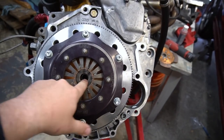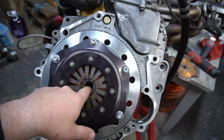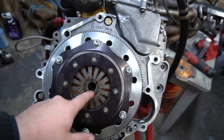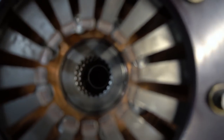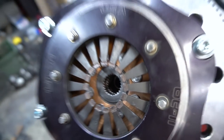We reached out to a friend at USP Motorsports who said he had a carbon clutch. I looked up the carbon clutch on Tilton's website — it says it comes with hardened splines. So do the hardened splines need to come on all 01E clutch discs? This is actually the standard cerametallic clutch with the hardened splines. I ran them for about three to three and a half thousand miles and the splines are still very new, very clean — no issues, no grinding marks.